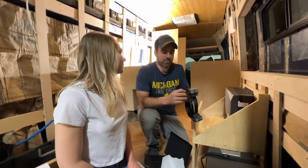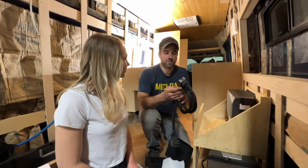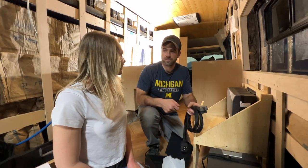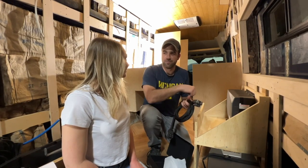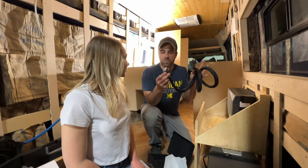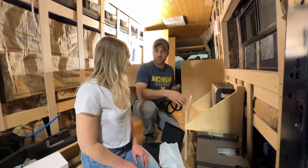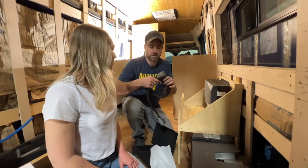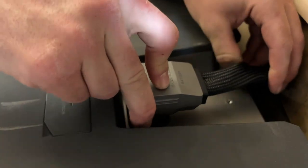How is that compared to the previous systems that you used? Oh gosh, so prior to EcoFlow coming up with these wire harnesses, I would have to take a hammer and essentially a little anvil, terminal crimp style, and beat the terminal head onto each wire and then secure them from the battery to a distribution bar. So they took all of that work out for me by providing us with these nice harnesses that just plug in to both the power hub and the battery. Wow. So it cuts hours out of my workload. Wow, you must love that. Yeah, it's incredible. Just plug it right into the face of the battery. Make sure you hear it click.